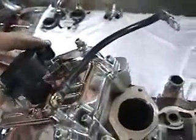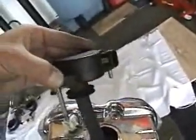Now I've loosened all the bolts on the coil packs on the rear and the front, pulled them out, and pulled out the spark plugs so you have access to get your covers off. When you remove these coil packs, notice that you have one short bolt and one long bolt. The front cylinder plug actually faces toward the rear of the bike, so you know that's the way it goes in. The rear cylinder also has a long and a short bolt, and again the connector is facing toward the rear of the vehicle. Connectors go toward the back of the bike.